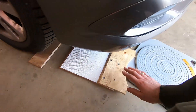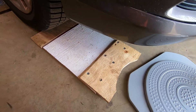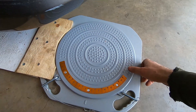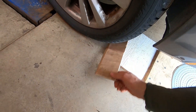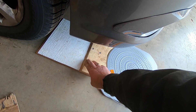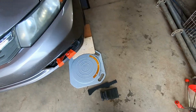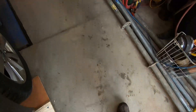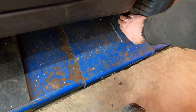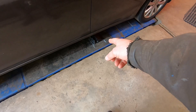I've built the ramp so on the front driver's side I push one ramp tight to the tire and then push the other tight to the ramp. On the passenger side the ramp is a different length so I'm only driving up one ramp at a time. I've built a little spacer so the ramp is positioned correctly, then I put the turn plate up against the whole works and pull the spacer out. The vehicle rises up very gradually. I've positioned the turn plates so when the tire is centered on the ramp it'll be centered on the plate. To know when to stop, I use the included wheel chocks — I measure back 29 inches, position both chocks, and drive ahead until I feel them slow the vehicle down and I'll be centered right there.